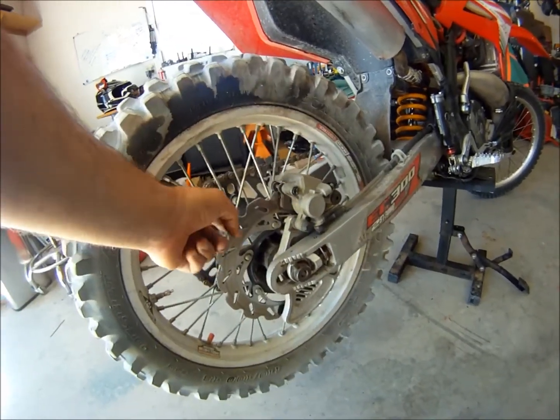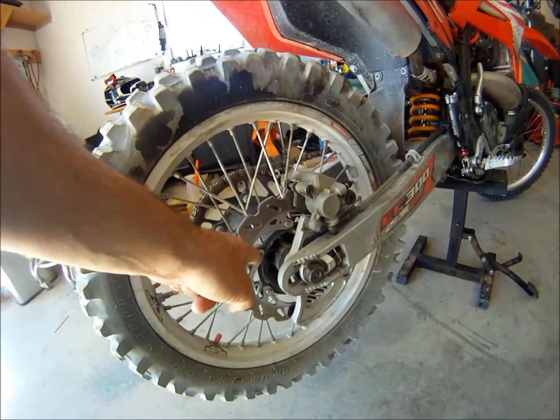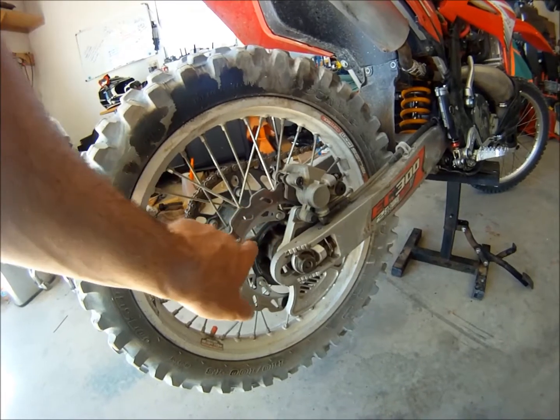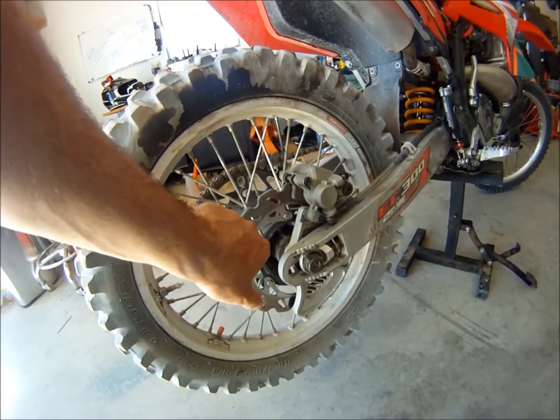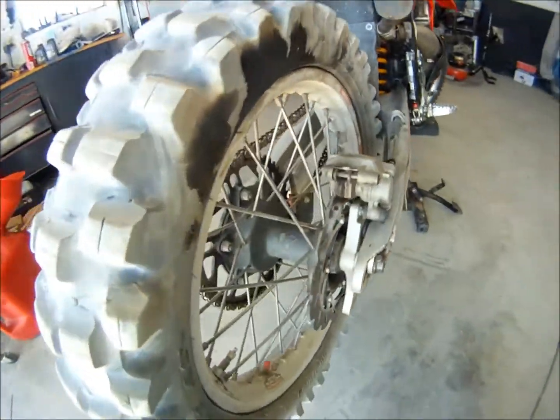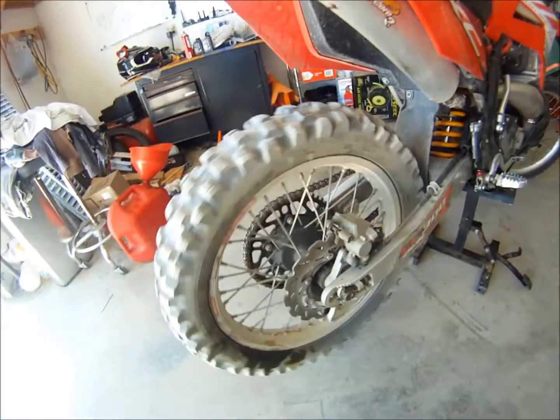So this is the 2010 Husaberg TE570 rotor, and the only issue was the bolts that I had on here, their shoulder. I just ground them down just a touch on each one just to make sure they recessed all the way in this little hole here. And with red Loctite, they've been a perfect fit. It's been on there for 2 years also, haven't had to touch it.